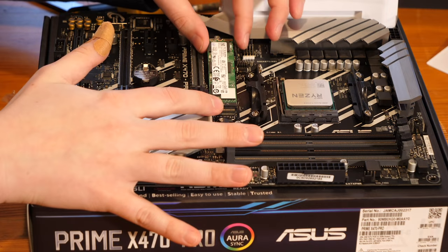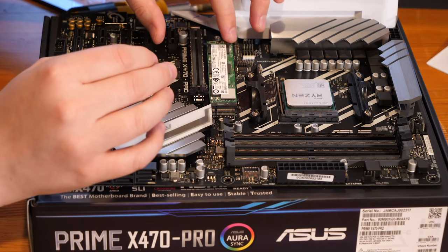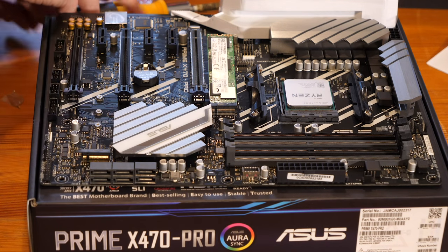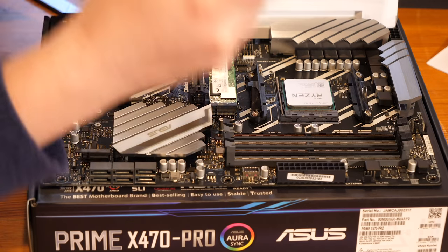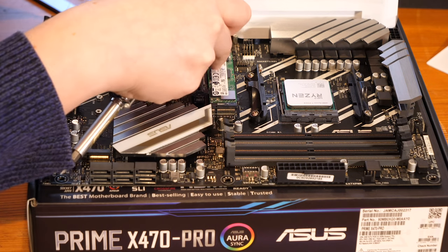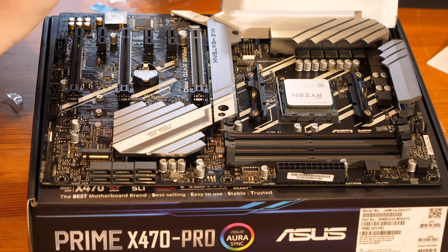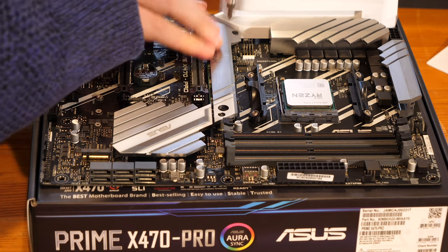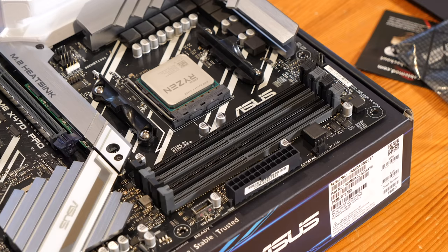The drive itself is very small, and like I say, it's not particularly exciting to look at, but it installs a little bit like laptop RAM does. So you place it in, and then once you're happy it's in place, you just use the screws that came with your motherboard to secure it horizontal with the standoff. And then I stick the M.2 heatsink back on and just tighten up the screws on there, making sure not to over-tighten. You don't want these things to seize up. You want to be able to get at them if you ever need to remove the drive.